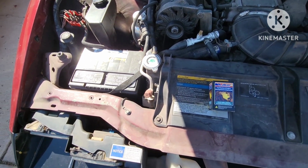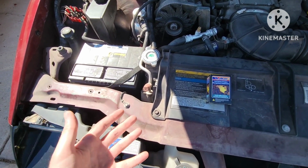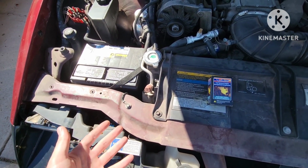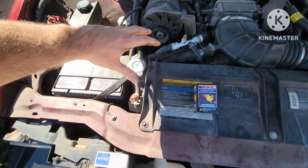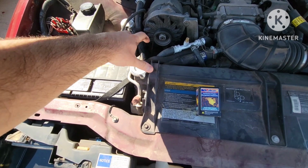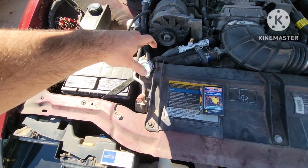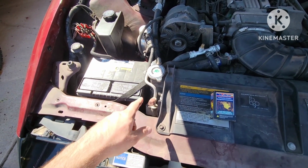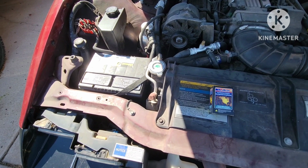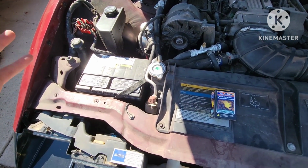If you are in a situation where you are on the side of the road, I would still try and wait absolutely as long as you possibly can, and then using a t-shirt or something to cover it, and then very slowly in gentle increments turning it, because sometimes you'll turn it a little bit, it'll seem fine, and then you'll start hearing it sizzling a little bit. You do not want to mess with a hot radiator, because there's been people that have been permanently scarred just from it splashing all over them.